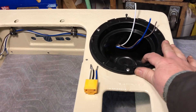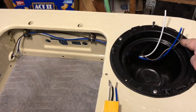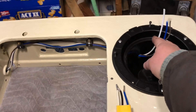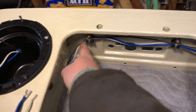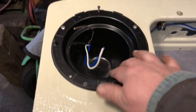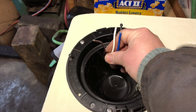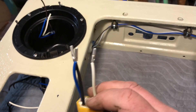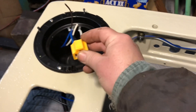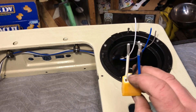I got the headlight buckets bolted in with a gasket seal around the sides and three screws. The wires are fed over for the left-hand side, down under here are the grommets. On the left-hand side I added the brown wire for the ground. I got the connectors put back together with connectors on the end, so I just need to attach them. Headlight sockets are done.